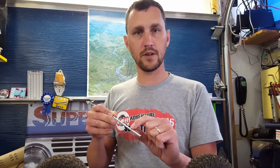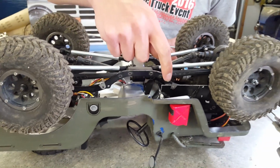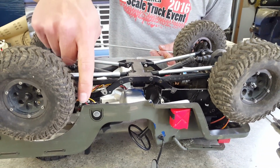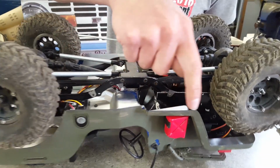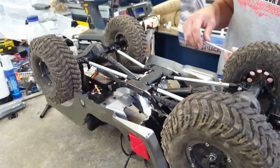If you're doing tabs over tubes on the side, like for shock mounting and stuff, then you can just weld them right on and they stay centered. It's a little easier to jig them together. So we got one in the front. And we've got one at the back. Hopefully the sliders will have a little bit of support onto the frame, and then a nice long straight run that we can bend around your body so that the body doesn't take the rash off the rocks anymore.